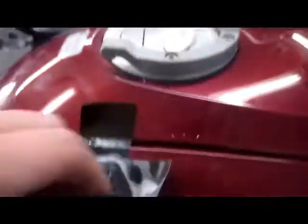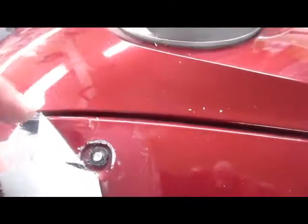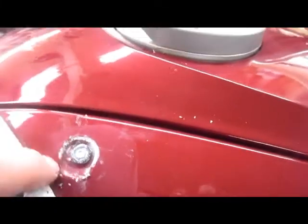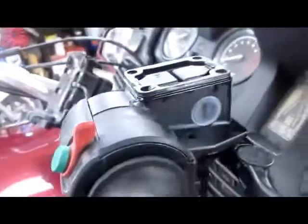Your goal with all of this is to not melt the panel. The panel is already scratched here because someone's had this issue before. Unfortunately, in my initial attempt with the vice grips, even with fresh duct tape on here, I still nicked a little bit of this back corner. But, you know, in this case, it's unavoidable. The fucking screw's cross-threaded. There's not much you can do. And it's easy to cross-thread these because these screws just don't start well. At least now we can get this panel off. And then we'll just figure out what's going on with his brakes.